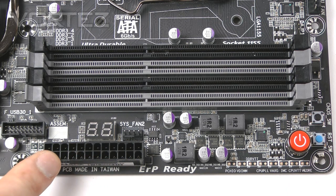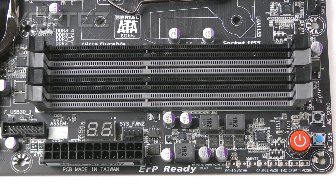We've also got the 24-pin power socket and an LED debug display just above that. It displays a code which you can refer to in the manual — so if you've got a troublesome boot or POST issue, it'll give you a digit and you refer to the manual to help troubleshoot. And just to the side of that we've got a USB 3 header, which is one of three on this board.